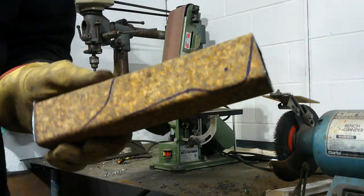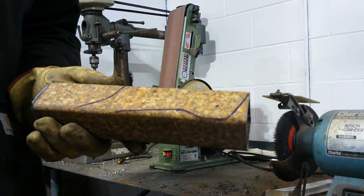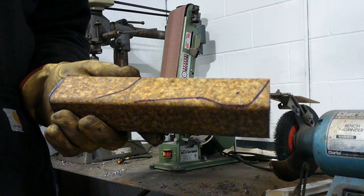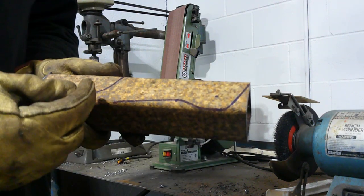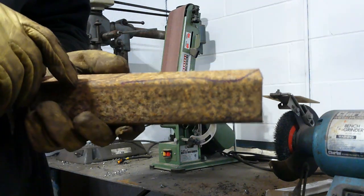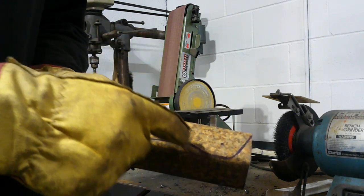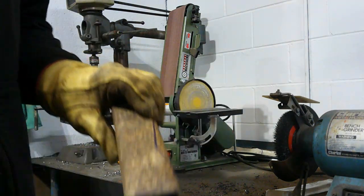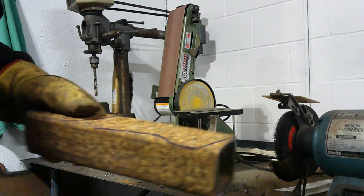Next thing I gotta do, I traced the other lower mount that I made onto this bar. And the way I got this outline and everything is I took the original shock mount that I cut off of the rear end and I held it up on the rear end, put my shock in where I needed it to be, and I noticed it was about an inch to an inch and a half more length that I needed. So I marked this upper line that's going to go on the rear end here at the length that I needed from the hole, and then I set my mount down there and lined it up where the hole was going to be, and then traced it so I can just kind of get the same look, I guess you'd say. So I got to put this in the drill press and pop that hole through it, and then we'll take it out and get after it with the grinder and finish making it up.